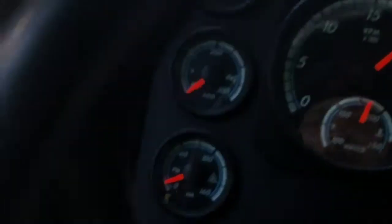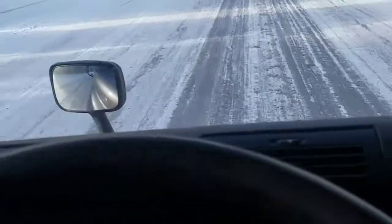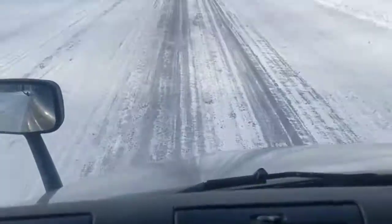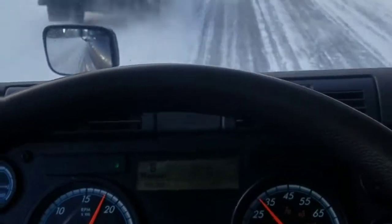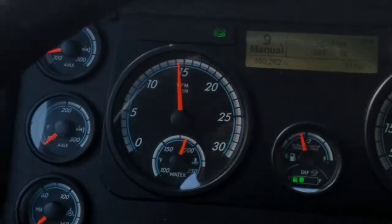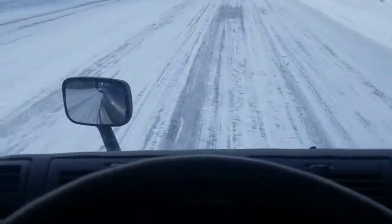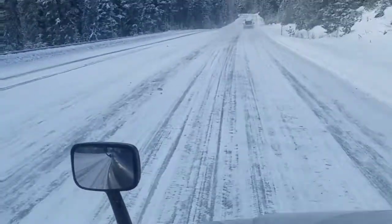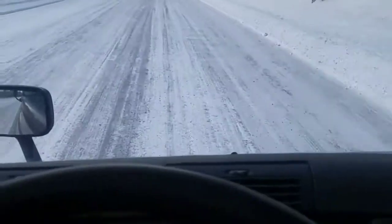We're running real high here — I'm going to start hitting the brake again. On this stretch we've used a little more than I'd like, so I'm going to get her calmed down. On the straightaway I'll get off the brake and let her cool down. May even go to ninth here to keep those RPMs where we like them — about 14. We pick up speed quicker in ninth too, so we're safe through this stretch. Always think ahead, look ahead. I know I can keep this for a minute as we pick up some speed.